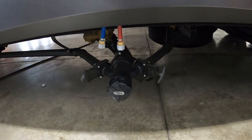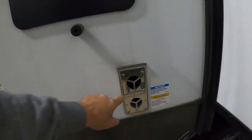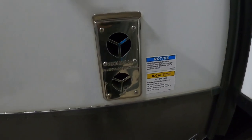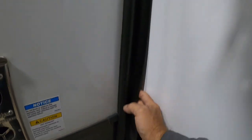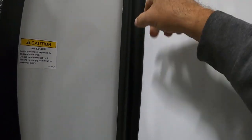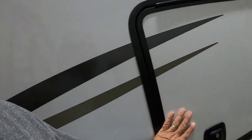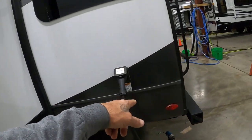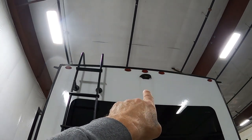Here are your black and gray tanks as well as low point drains. Your hot water heater and a docking light. The furnace exhaust — make sure you steer clear as it does get hot when running, and make sure nothing's ever blocking it. The slide wiper seals need a fluid applied to them occasionally to keep them from dry rotting over time. There's a vent for your cooktop and another storage area back here. Your power is here — use that ladder and go up a couple times a year to check the seams of your roof and caulk as needed with recommended RV roofing caulk. There's also a prep for a backup camera.